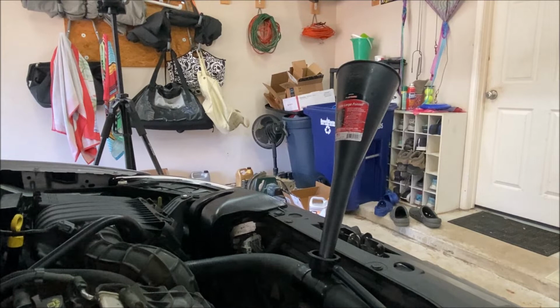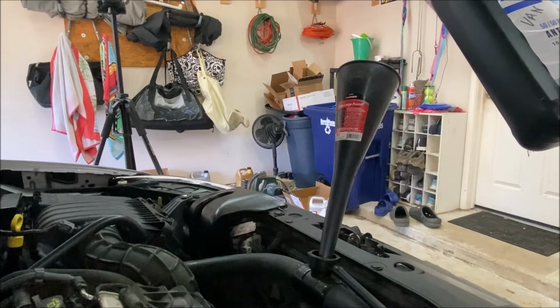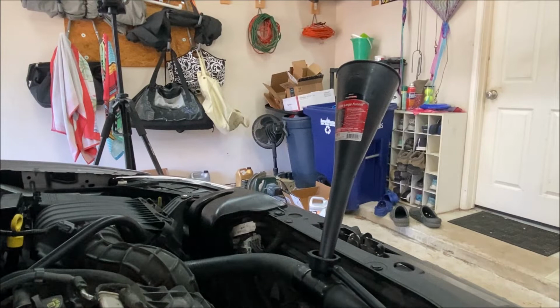It's really important that you use the right formula of coolant in these vehicles. This particular vehicle uses a Mopar spec of MS12106. You can see it right there. But really, it's just the OAT formulation. There are other vehicles like my Jeep Wrangler, the 2011, that uses HOAT. And that is not what you want in this vehicle. You want the OAT. And I'll put a link in the description of the coolant that I'm using.